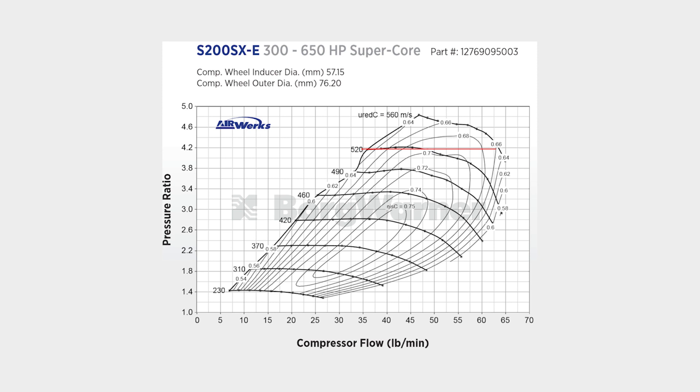So you've only lost 5% efficiency — not that you'd really run that kind of boost pressure. The typical application would normally find you at about 2.4 bar boost to max out the turbocharger, specifically on race or drag type applications, depending on engine size of course.